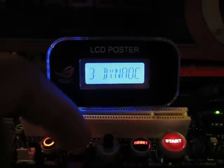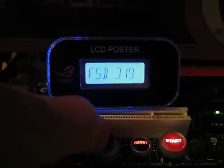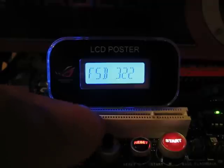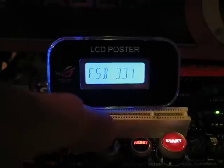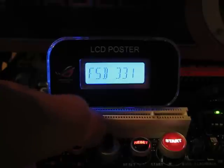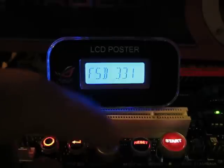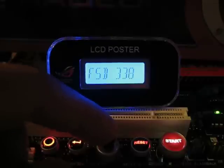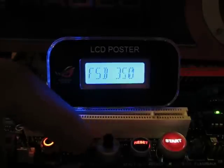If you want to dynamically overclock the board — which is huge — I use this basically for tests that involve single-threaded and multi-threaded benchmarks, like PCMark or the 3DMark series, with the quad-core tests in 3DMark Vantage and 3DMark 06. If you're running 3DMark 06 game tests 1 and 2, these are really easy tests for a processor and they only stress one core, so you can get away with pushing the FSB up considerably.